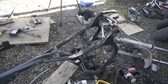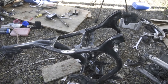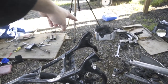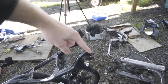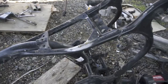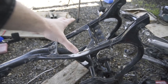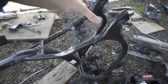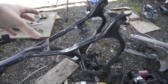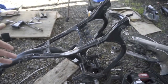Today we are working on the frame. In case you forgot, this is the Honda CX500 frame. To be honest, I've almost forgotten - it's been so long. Basically what I did is chopped off the ends here. We're going to be creating like a frame hoop, like we did on the XL100S build series. Today what I'm focusing on is getting all this completely paint-free so we can weld on some brackets for the seat. Once we get that welded on, we can actually paint prep the frame and get this painted.